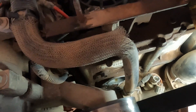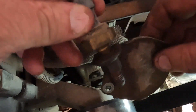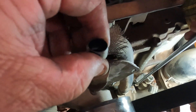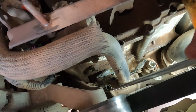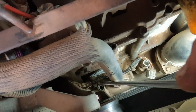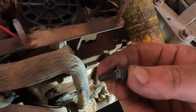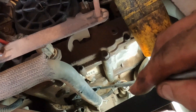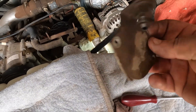We can start on the front. We're going to have to push this down here further. This mounts on this front cover, which we have to take off. We'll have to disconnect this electrical connector from this - it was way down in here. Have to disconnect this connector. The bottom of this is screwed onto the bottom, the top is your pipe. You'll have to undo that - that's a 5/8 size nut. You'll have to take out these two 8mm head bolts - one is right here, the other one is over here. When you take those two out, this is what comes out, but it's glued so you've got to pry it off.